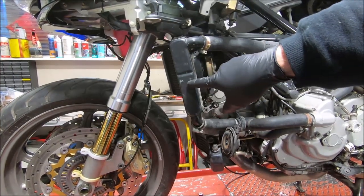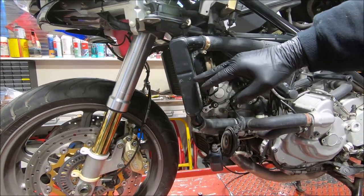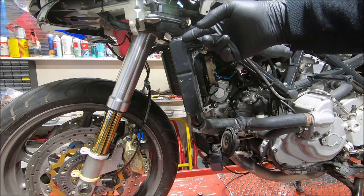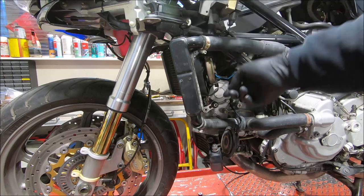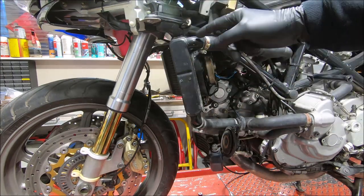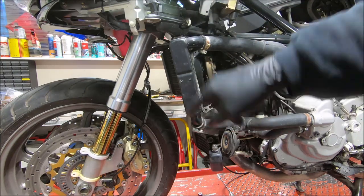Just here, there's two rivets you can see. The baffle plate blocks this left hand tank because the coolant comes out of the engine into the radiator here, goes across the top, back across the bottom and out here. So this plate stops the coolant bypassing the radiator.